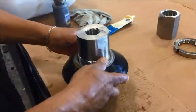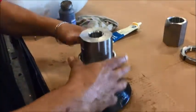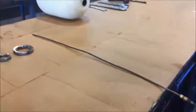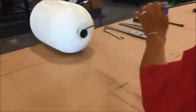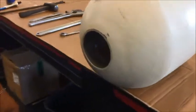Go ahead and pre-fit the extrusion ring onto the oil port — it has to slip past the O-rings — then put the spacer on. It's going to bottom out; let that set for at least five minutes to pre-form the seal on the oil port. Prior to assembly, the shell must be thoroughly cleaned; use high-pressure air to blow out the shell. Look inside and make sure there's no debris left.